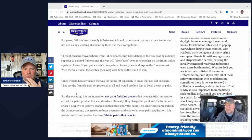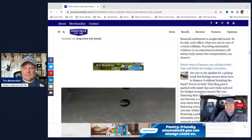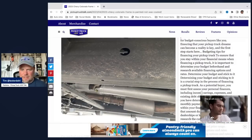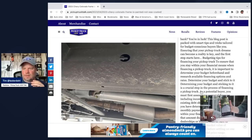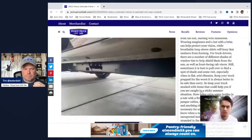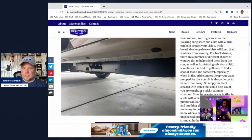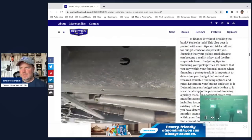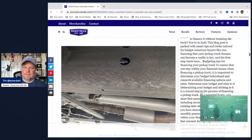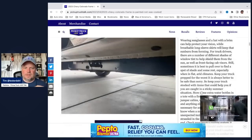So I go through the story and talk about e-coating, confirm the 1500 has a wax coating — you can see it right here. I put a little scratch in it, though you really can't tell on camera unless you're really up close. And I can show you this painted frame here. The painted frame definitely looks cleaner, it looks easier to work on. You can see more scratches but it doesn't get in your way. A lot of mechanics and people that do bodywork don't like the wax frame because it's hard to get it looking perfect — it's constantly fighting with it a little bit. Whereas with the painted frame, you can make it look pretty good.